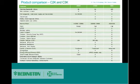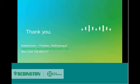Other points to highlight: flexible NetFlow is supported only on the 2960X, and that will support only NetFlow Lite. For the 3750X, we have NetFlow support with separate uplink service module cards, but the 3850 will support software NetFlow as well. Points to be highlighted: converged access is only supported on the 3850. So this is about the 3850 series.